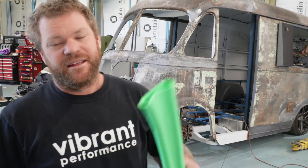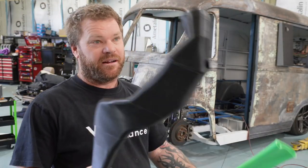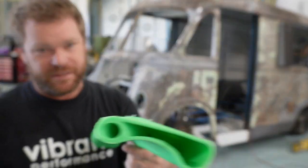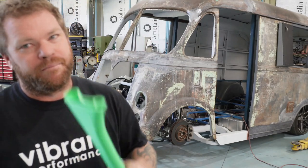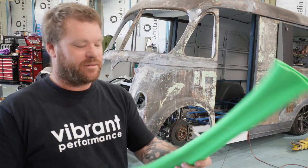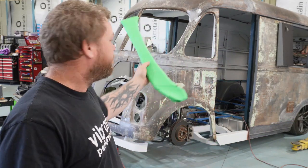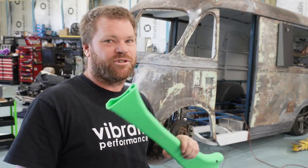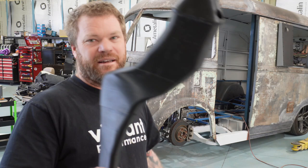The time has come to install these bad boys. I had the van 3D scanned a few months back and I spent a lot of time on a computer drawing these up. I did print them out of PLA green, but PLA softens at a pretty low temperature, and being that they're going to be up against the steel of the van, I don't want to risk putting PLA in there and have it going all soft and munted. Because once these are in and the pillars are welded back together, these will never come out again.